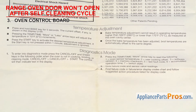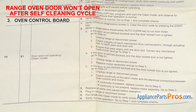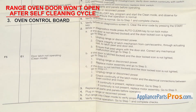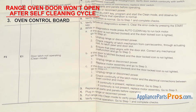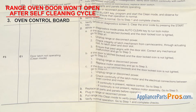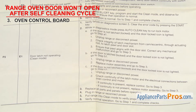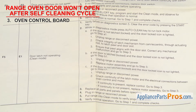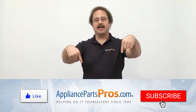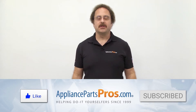In this example, you'd have to enter diagnostic mode, press self-clean, and follow the troubleshooting steps — this sends power to the latch motor. If the latch motor tested good but the motor doesn't operate during the test, it could be that the motor relay has failed and isn't sending power to the motor. If the relay is bad, the board will have to be replaced. Hit those like and subscribe buttons to help support us making more of these videos.